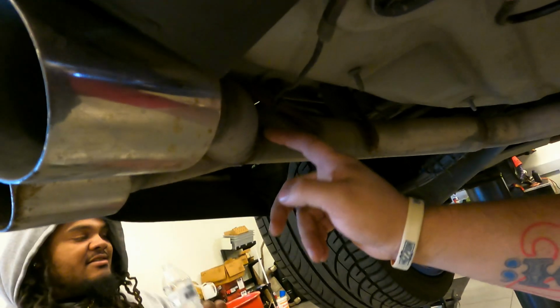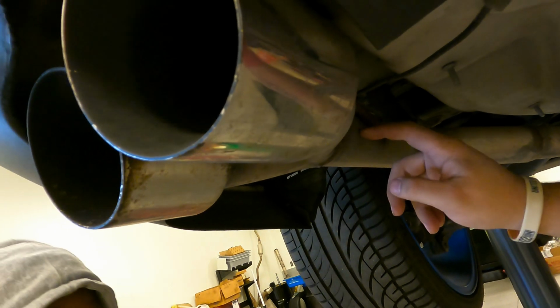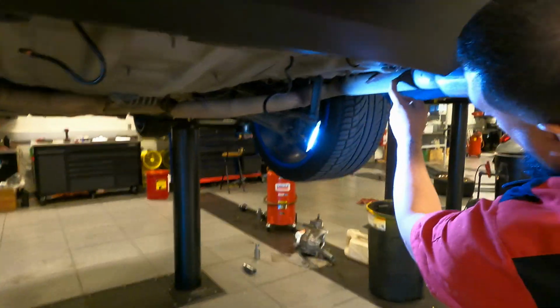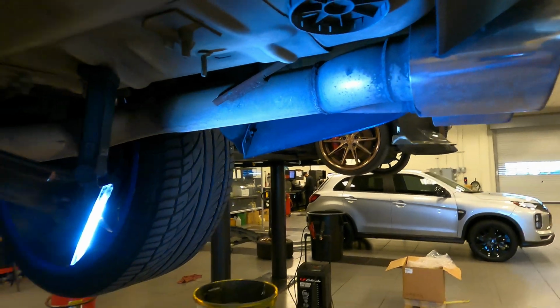So yeah, it's probably going to be in this area. With this bend in your pipe, 10 inches is about here and about 11 or so is right here. I want to say that's a good spot. That's where it was pointed earlier without even measuring. Same on this spot, about right here. So that's what we're going to be drilling, more holes on the pipes.